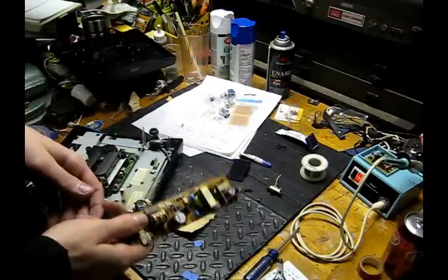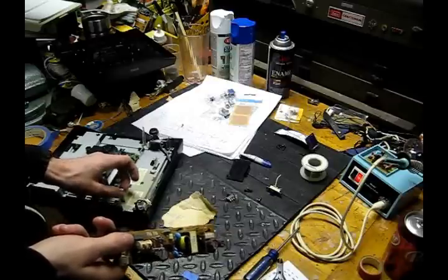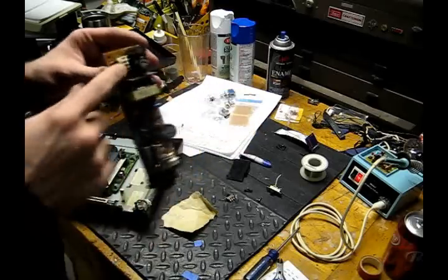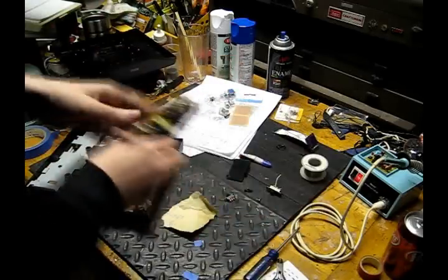Because one time when I was doing the swap trick, playing with this door close button, that happened. My Saturn wouldn't come back on. I messed with everything, and as soon as I reseated this connection, it came back. So keep that in mind.